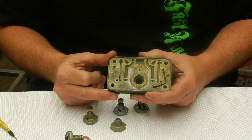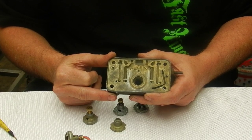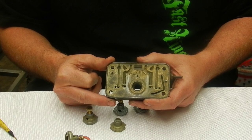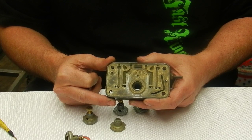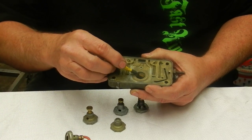If you put the biggest power valve in to start with, you're not going to have a problem. Just make sure you've got the right vacuum rating. If you're running 12 inches of vacuum at idle, make sure you've got a five-and-a-half or six-and-a-half power valve. For an automatic car, check your vacuum in gear too — not just out of gear. For a standard shift it doesn't really matter.